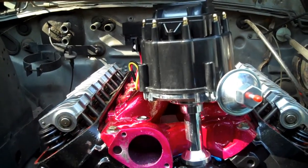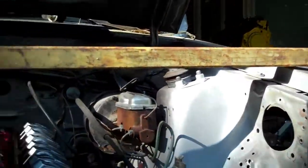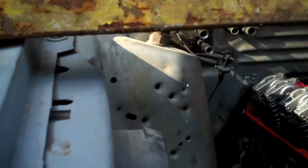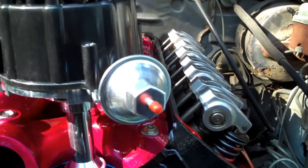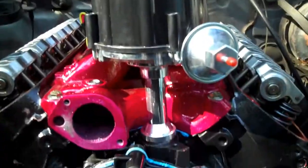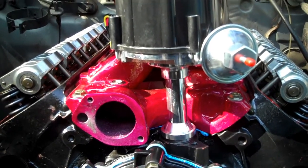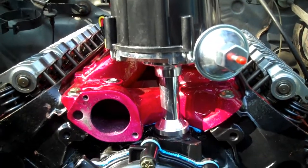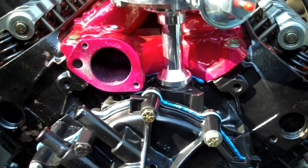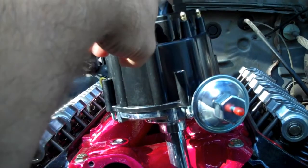What I discovered is I'm a little worried about hood clearance issues. Using a straight edge as a fender defender, you can see there's a little bit of concern because it's sitting on top of the distributor cap. Bear in mind the distributor is not totally seated - it's still got about a quarter inch to go, because below it is a drive shaft that runs the oil pump. The motor is totally fresh, never been started, so I'm just going to accommodate that extra quarter inch.